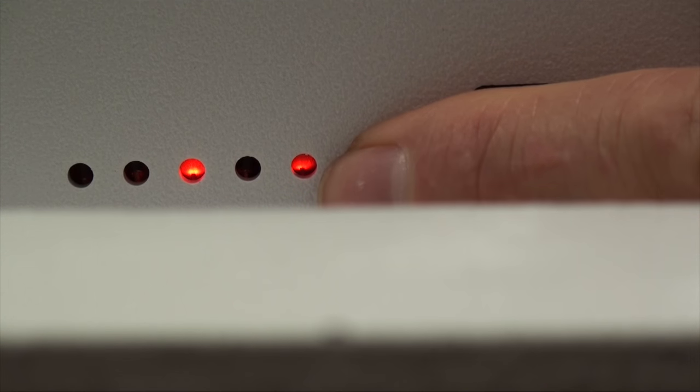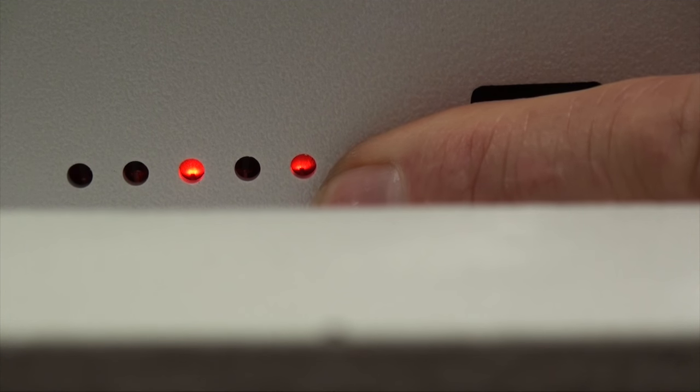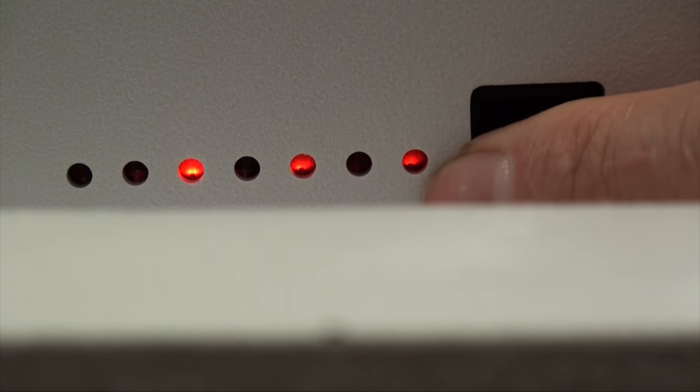By testing the motor sensor and the needle sensor, we've identified that the motor sensor is the bad part, or that the hand wheel is not in the proper position — and this is why it wasn't flashing. So let's see what we have to do to test that.